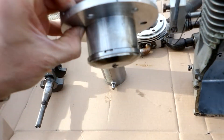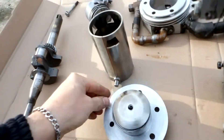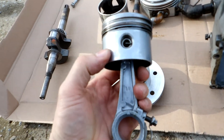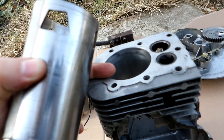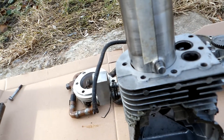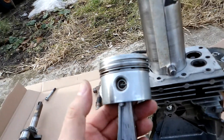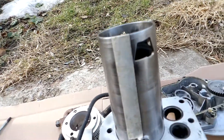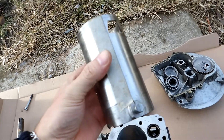The junk head is circular and forms the combustion chamber, paired with a regular flat-top piston with the connecting rod — all stock in this case. It's an eight cubic inch Briggs and Stratton. The sleeve bore is two and nine-sixteenths inch — this is approximately a 1980-vintage model. The eight cubic inch engine has a two and three-eighths inch bore, so I used the gap between them to allow for the thickness of the sleeve. It's thicker than it needs to be and weighs about a pound.